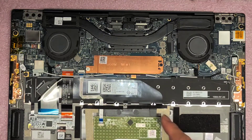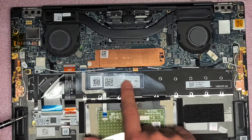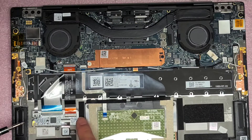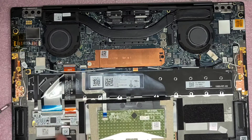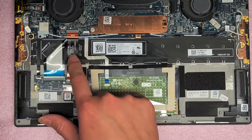Because this computer turns itself on, you want to be very careful and remove the battery connector anyways. Here you've got the keyboard connector that plugs to this board, the keyboard backlight connector that plugs to this board as well, and then the connector that goes from that board to the motherboard. So the keyboard and everything connects to the motherboard using this one cable. There's also this cable that goes down here for the LEDs on the front.